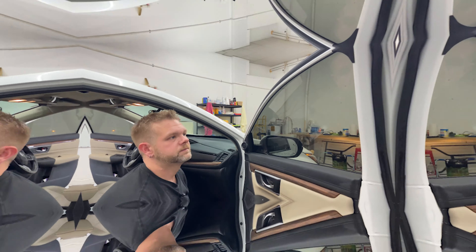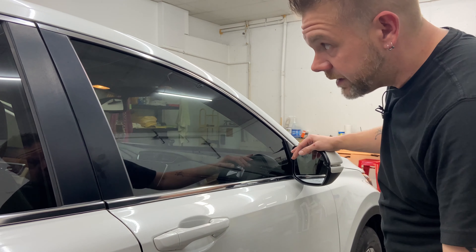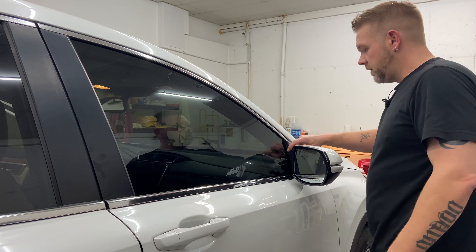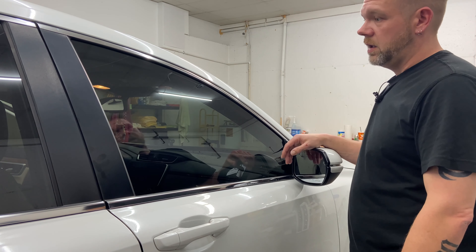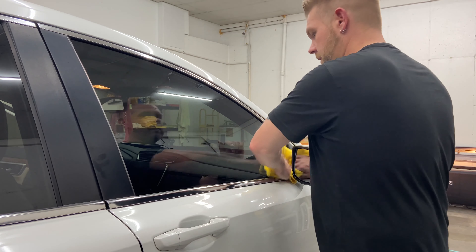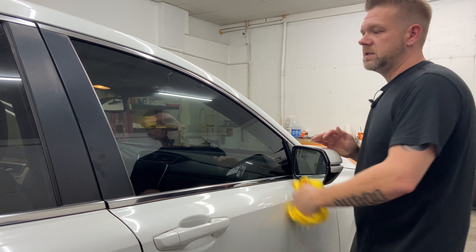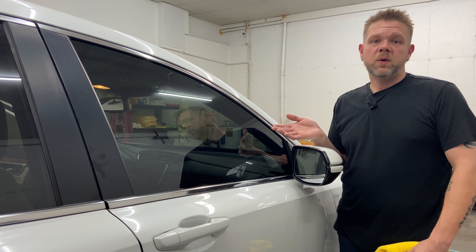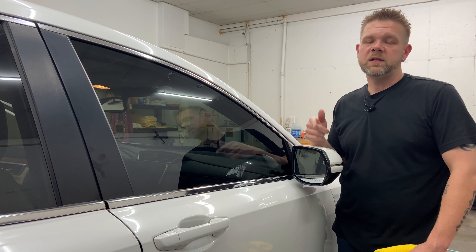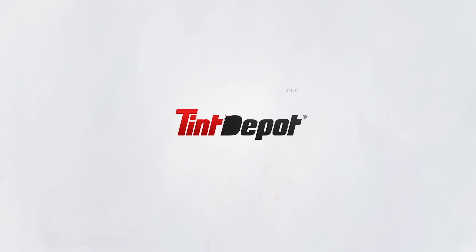We'll check the outside and see how we did. It's installed and it looks really, really good. I don't see any contaminations. Checking my edges, checking the bottom, any fingers or creases that may have crept up — but this window looks really, really good. Totally passable, totally acceptable — actually really good. Make sure to check it over; if there's anything major, take care of it if you can, otherwise redo it. And that's the basis of installing window tint on a framed door window. Tint Depot's Superior Charcoal 20% on this one, guys. TintDepot.com — all the tools and tint you need. Thanks for watching.